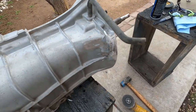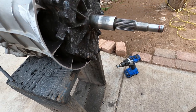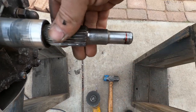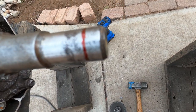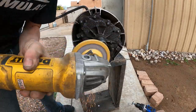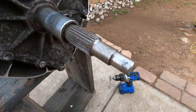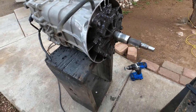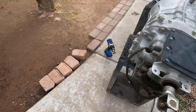Got the nubs on that side cut off, everything's all nice and cleaned up — no more nubs where it connected on the bell housing. Got the input all cleaned up and now we have to cut off three-eighths from the end of it. No idea why, that's just what they say. So I'm gonna cut off three-eighths and then give it a little bevel just like OEM. Got the three-eighths all cut off, nice and beveled, looks pretty good. Hopefully the clutch will fit on there really nice.